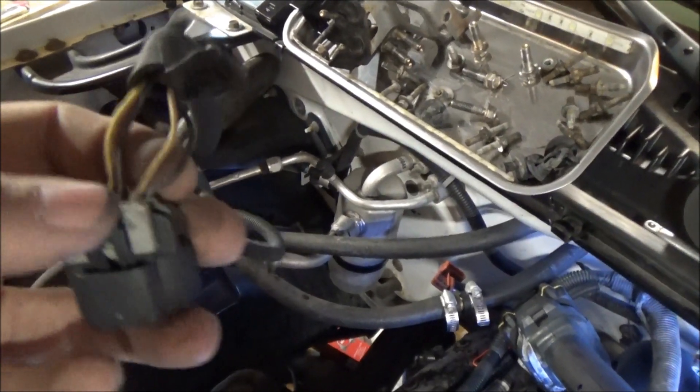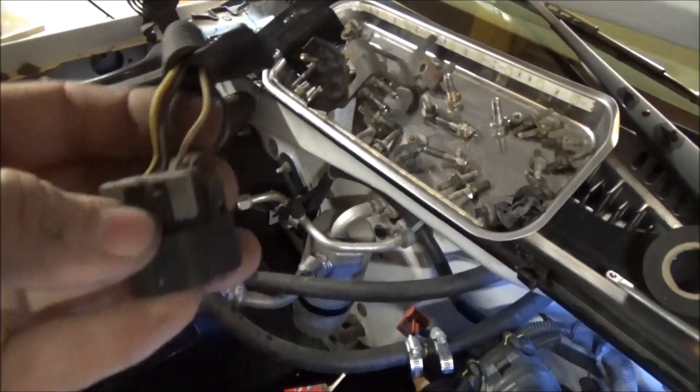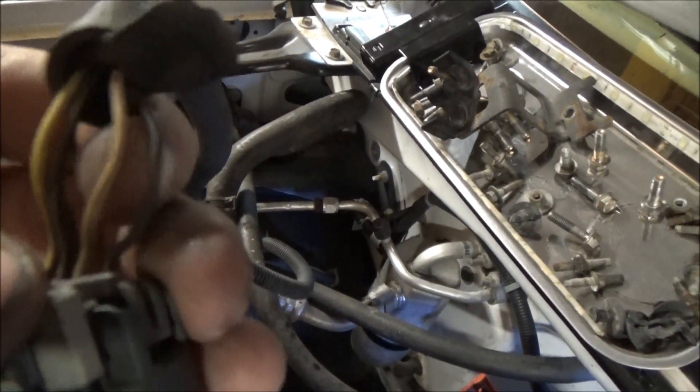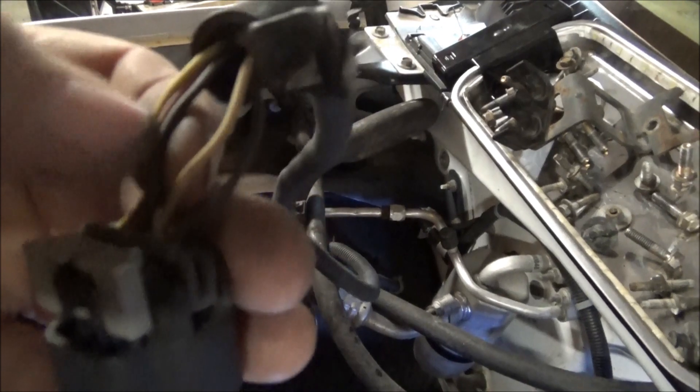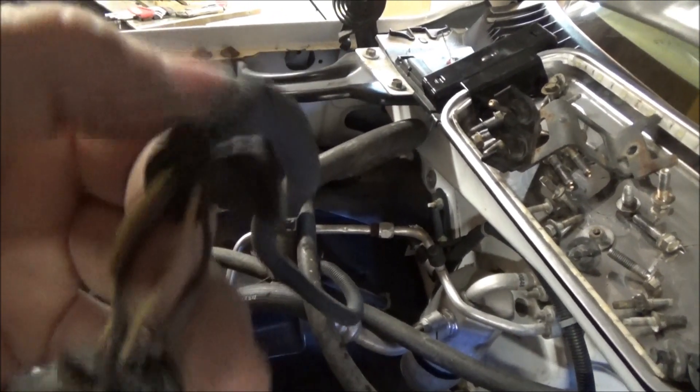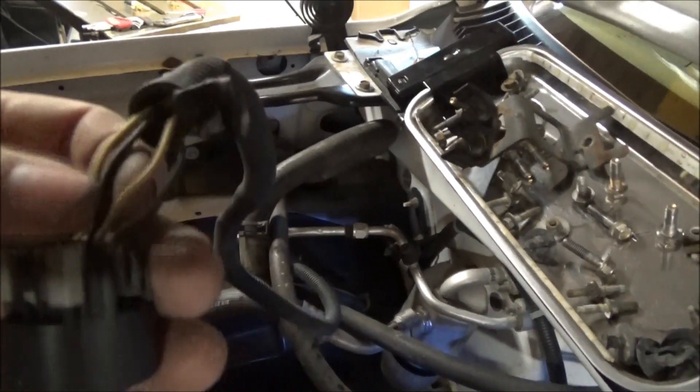All of the pigtails are done for the injectors. Now I want to show you how to hook up your IAT sensor. Remember the IAT sensor pigtail is labeled A and B. When you hold the mass airflow meter switch towards you like this, A will be over here — this dark blackish one — and then we have tan, so that'll be A and B. You simply connect A and B to A and B on your pigtail regardless of the color. The one I bought has brown and purple. These other three wires are for the mass airflow meter only, so since they're not getting used, I'm going to cut them off deeper and let them nestle back in the loom.